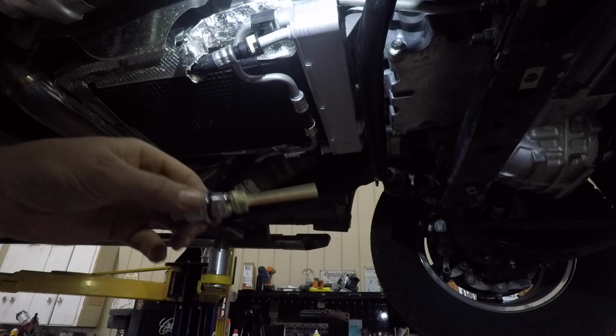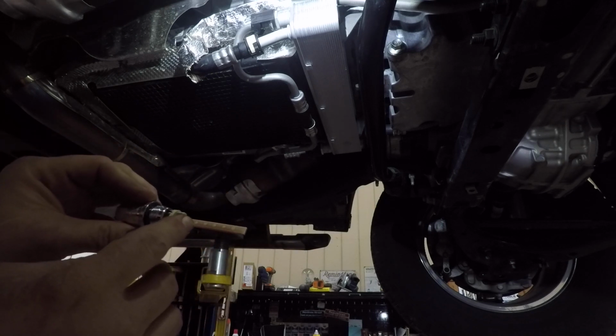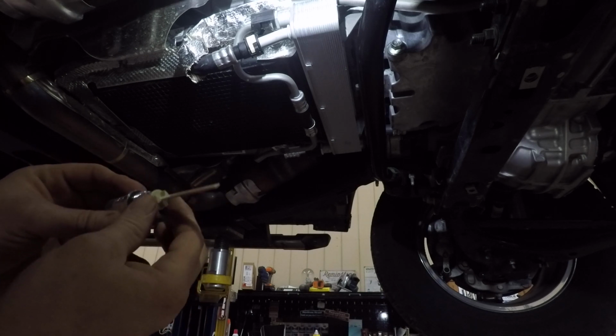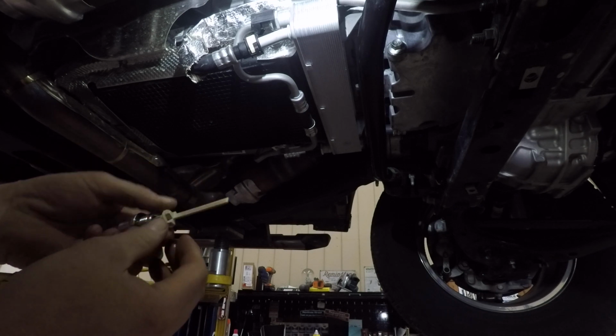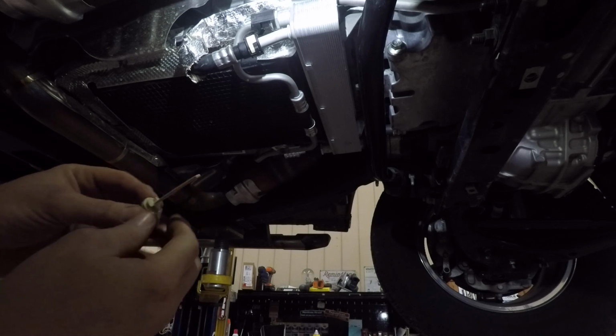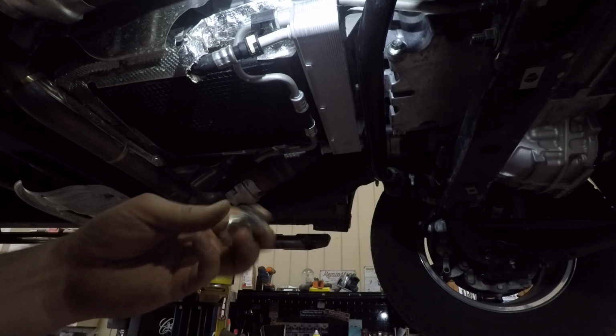And there's how you check your fluid level at operating temperature, and there's some marks on here you'll have to identify, which is your hot and cold fill or whatever. It should be at operating temperature. So this engine's not running, of course, so it's going to show high. As your engine starts up, it's going to pull the fluid down a little bit. And this comes out of here, and this is your cap, and it's got a part number on here.